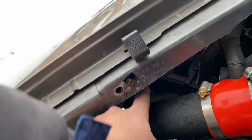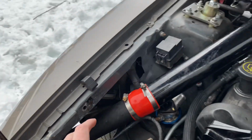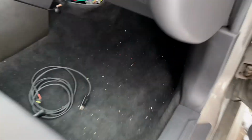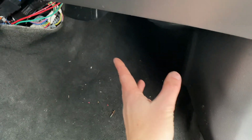This is your CCRM right here, in the fender well. It's basically a big relay pack that sends power to a few different things in the car, but mainly it sends power to the fan. You can also find this in your wiring diagram. There is a fan high wire that goes to where the stock ECU went in that big plug. The wire color is light green and violet. You find that wire and it has to be grounded. When you ground that wire, it triggers the relay and sends power to the high speed fan.